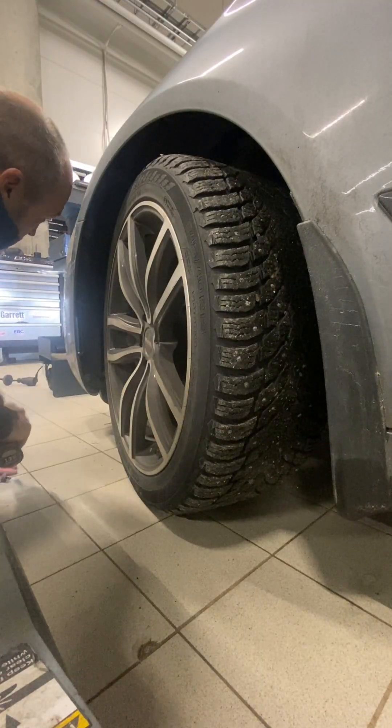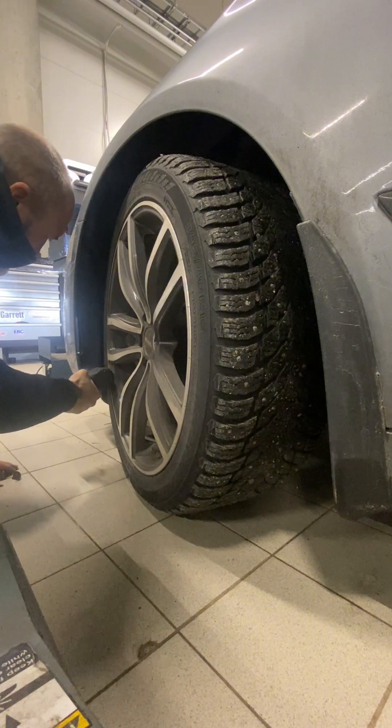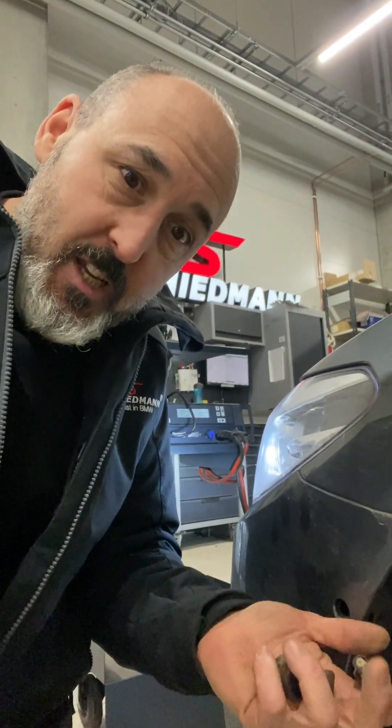If the fault transfers then my morning's going to be easy - I can go for a quick brew. It's full of salt - look at the bloody state, grit and salt all over the damn thing. The trouble with BMWs is that they can't differentiate between a shorted sensor, wires shorted together, or open circuits - as in not connected. They give the same fault code: front left sensor open slash short to ground or slash short to battery voltage. They don't know the difference, they just know there's a fault. So it's up to you to find out.